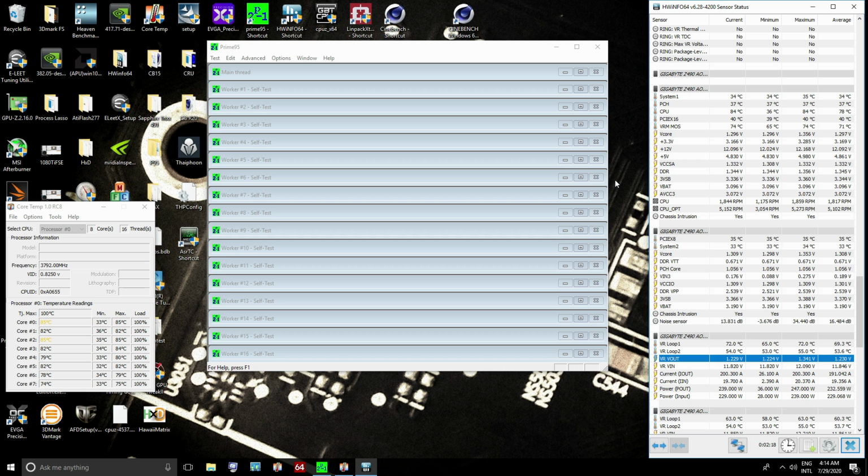The thing is, you're actually leaking airflow through the powered off fan. So the fan that isn't spinning, you're losing a bunch of air pressure to it. So there's less air actually passing through the radiator, even under the fan that is still turned on, which is kind of annoying. Anyway, 87 degrees, as you can clearly see. This is way more stable than before.